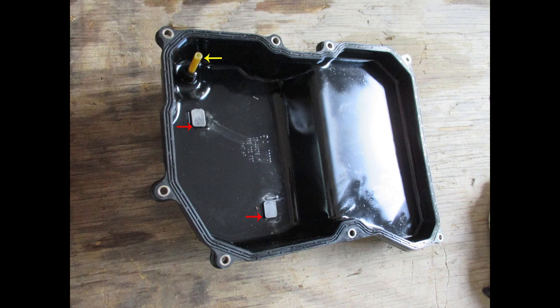You see the cream-colored tube with the yellow arrow. If you fill your transmission too full, the excess can be drained off — it will go down that tube, leaving you the proper level in the transmission. A weird way to do things, but that's a VW for you. To drain all the fluid out you remove the entire assembly. You're supposed to fill this transmission up, overfill it slightly, run it through the gears, and then when it reaches full operating temperature, remove the little drain plug for the cream-colored tube, and that will drain just the excess.